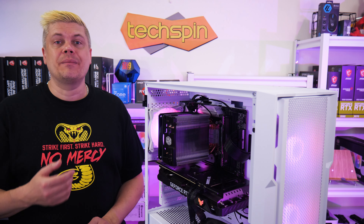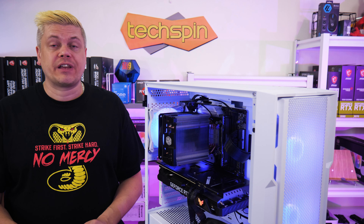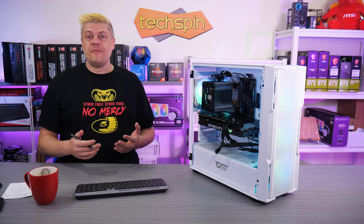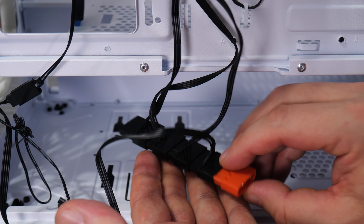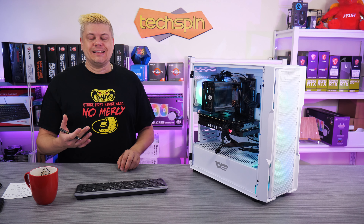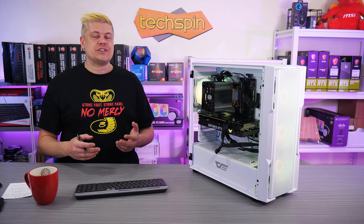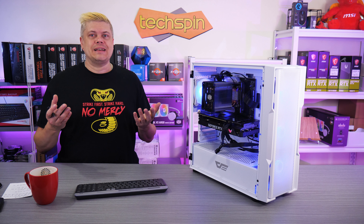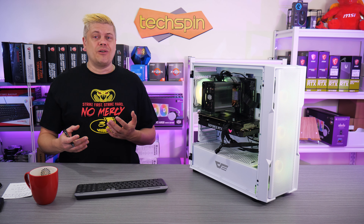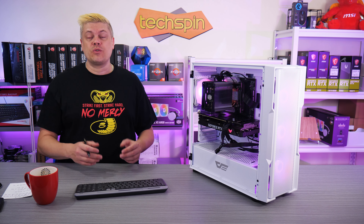New cases on the market like this one are built longer specifically for the RTX 40 series graphics cards, so for gaming this case falls short. Instead of using 4-pin PWM fans or even 3-pin DC, they're using a special Molex daisy chain for both power and ARGB — yes, that's as terrible as it sounds. The fans won't ramp up to the massive heat load from a new RTX GPU, quiet and oblivious as they don't connect to your motherboard. In their attempt to save costs and perhaps create their own fan ecosystem, they've effectively eliminated this case from new production or gaming builds.